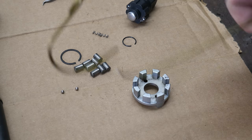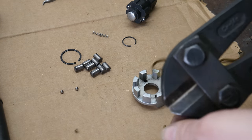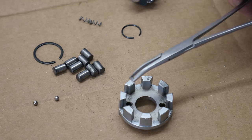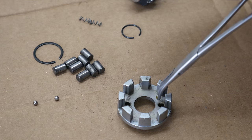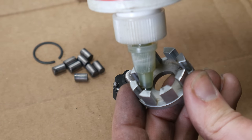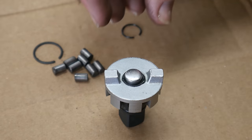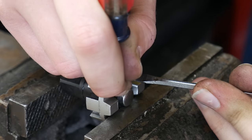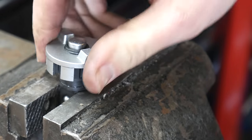We'll install little spacers behind the springs to force them to be compressed more and hopefully make the detents stronger. We'll make these spacers out of little pieces of coat hanger since they're just the right size to fit behind the springs. We ended up trying a few different lengths of spacer to make sure the springs still have room to move, but are as tight as possible. To make the check ball part of this assembly easier to put back together, we'll use a little bit of engine assembly lube to hold things in place. Then we'll line up the parts and use the vise to help hold it still while we get that snap ring back into its groove. And once it's locked in, we can feel exactly how tight the detents have become — it's a significant improvement.